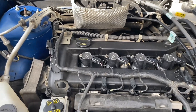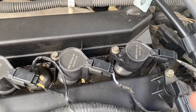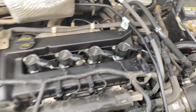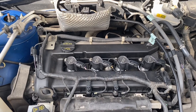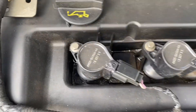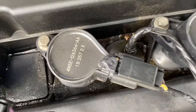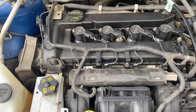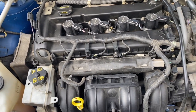These ignition coils are actually pretty easy to change out. All you need to do is remove an 8mm bolt, wiggle it out, then press down on this little clamp and it just pops out — literally takes about five minutes. I actually changed out my ignition coils in a Walmart parking lot. I also took some brake cleaner and cleaned up the area as best I could, though there were some tight spots I couldn't fully reach. It'll get fully cleaned next week when we do the valve cover gasket change.